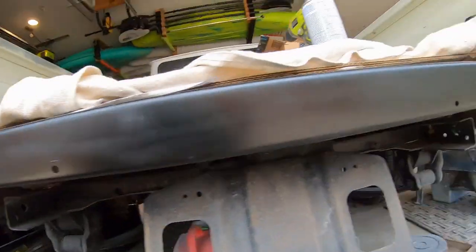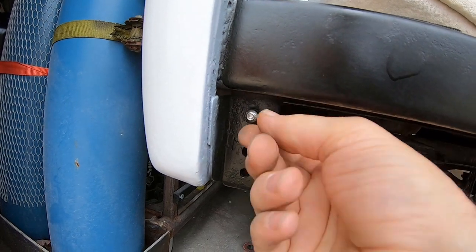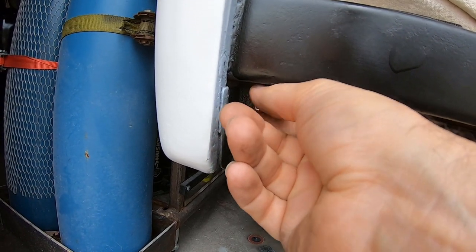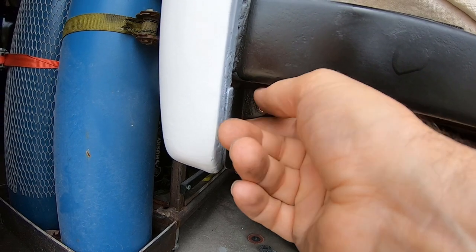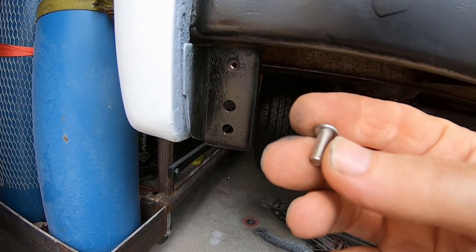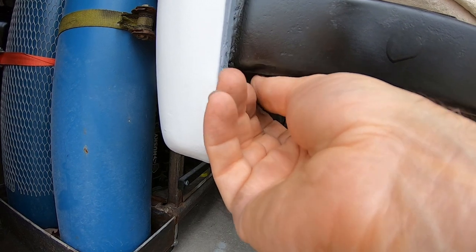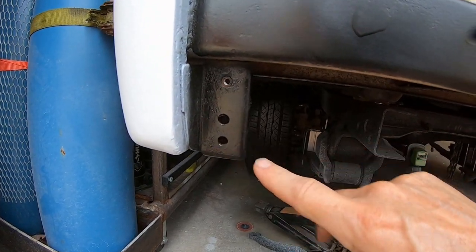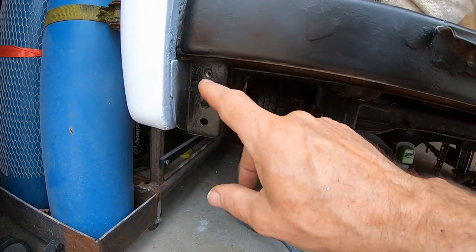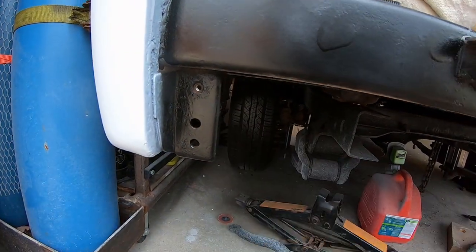The original bolts are 5mm by 7mm, just like the front turn signals are 5mm. I converted the whole front end to 5mm - if it wasn't metric, it is now. I ran a tap through to get rid of the rust since these holes have been empty for a long time. I'm using stainless button head screws from Lowe's - they look really cool. I'm using them on my grill too. I'll probably use them here with nuts in a few spots - maybe three here, two on the light, one there.